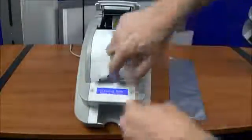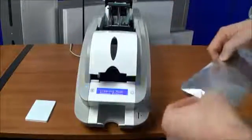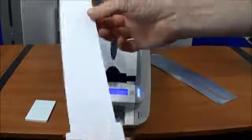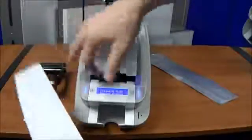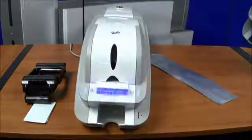At that point, remove the cards. Get your long cleaning card ready. This is an alcohol-based card and it's only good for one use. Remove your ribbon cassette. Put the long cleaning card into the printer and close the hood.